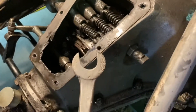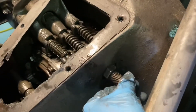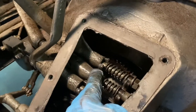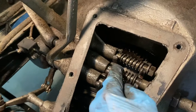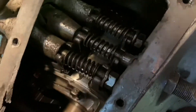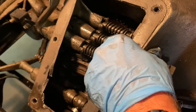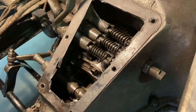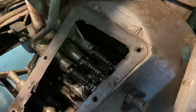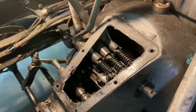We made a few adjustments using our authentic Ford tools. We backed off this one bolt, which allows you to make the actual adjustment — once it's backed off, you can either tighten or loosen the band. Tightening it causes the bands to constrict together. We made just a small adjustment so the pedal still constricts the band when pushed down, but we want to make sure we didn't go too tight and cause forward creep. We'll put it back together, start the car, and check for forward creep or insufficient pedal action. We can also make further adjustments through the external adjustments without removing the plate. Now we'll clean off the magnet and put it all back together.